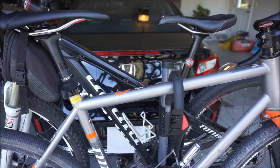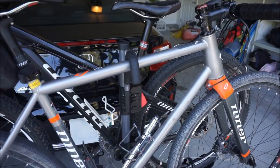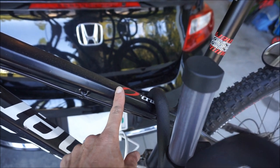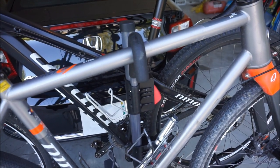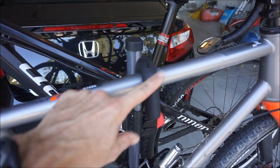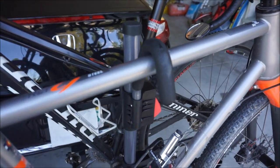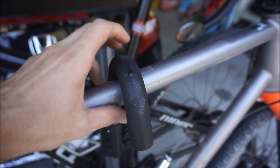I've loaded my wife's mountain bike to show what two bikes look like on this rack. A couple of tips: Yakima recommends putting the heavier bike on the inside, which makes sense. But the real priority is the bike with the lower top tube — put the lower top tube bike on the inside first, and then on the outside the bike with the higher top tube, because if you don't, the hook won't go all the way down. Another tip: I use frame saver tape just in case. These hooks have pretty good padding — not real plush, but it seems pretty durable — and the hooks are the only part of the rack that will touch the bike.